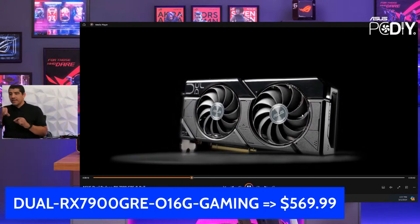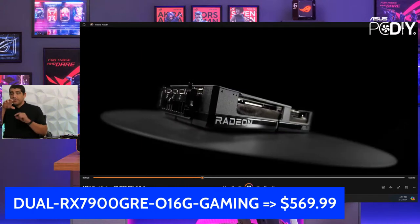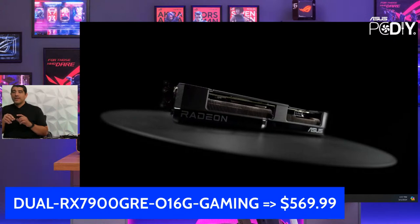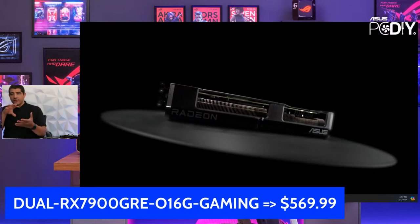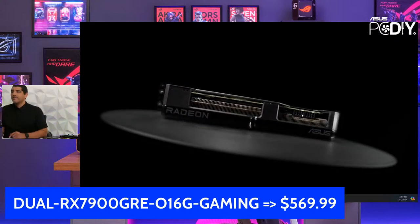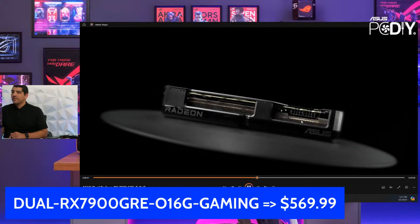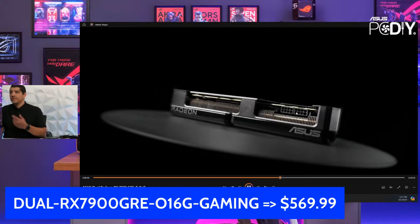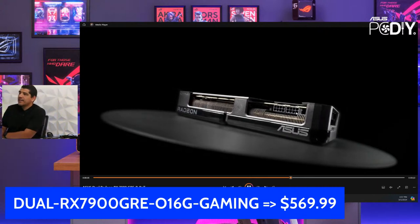You do get the newer axial-tech based fans with the ring barrier design. The ring barrier design means that on the external portion of the fan blade housing, it actually has a ring, and that helps to focus static pressure into the heatsink and the fan assembly, which you can see right there. You have two, of course, 8-pin PCI Express power connectors right there, so very easy to be able to power. It's not a huge amount of power.